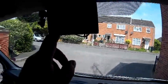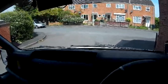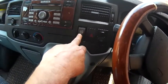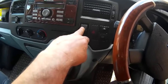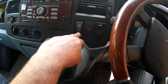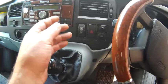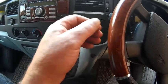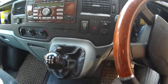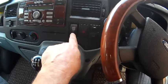That runs the sat nav and also the dash cam which mounts up there. The reversing camera and screen only come on when it goes into reverse. This has got a charge relay in it — at the moment the green light isn't on. That means when I start it up, the van is charging the leisure batteries. Turn it off and the solar panel is charging the leisure batteries as well, so that carries on and charges the van batteries too.